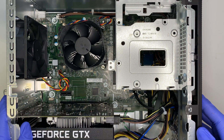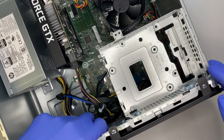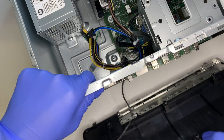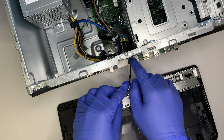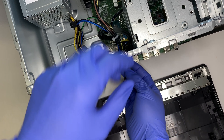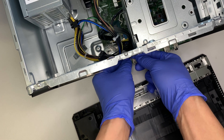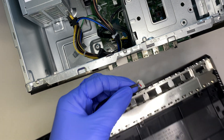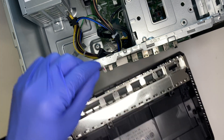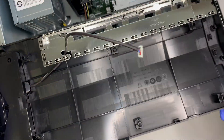The next part is you want to remove the front cover. To remove it, you just lift the tab up a little bit — there are three of them, second and third. Once you remove those, the cover comes loose without any problem. There is a cable connected to it; to remove the cable I'm using two fingernails to slide underneath the white connector and lift it up. The connector is just pushed down to the motherboard — to remove it you lift it up.